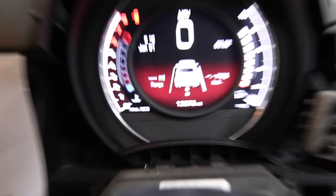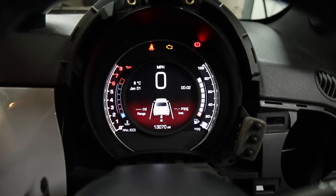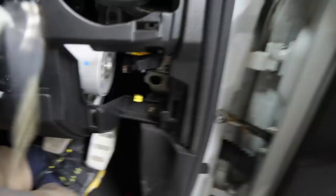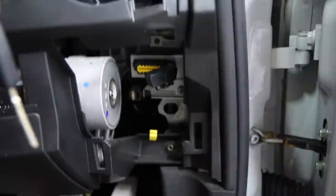The only thing that's wrong now is the mileage. If you look at the bottom you'll see it's showing 13,070 miles, taken from a relatively new car, so we need to put that right. To do that we need to use Multi-ECU Scan, which we have a licensed copy of. We need to plug into the OBD connector. On the Fiats and 500s the OBD connector is on the driver's side just behind this panel, which just pulls off. Down below you'll see the OBD connector.